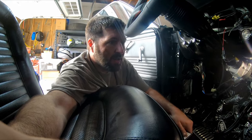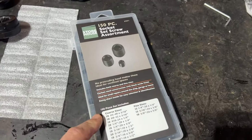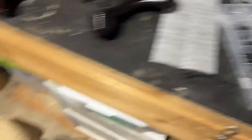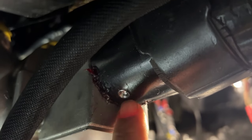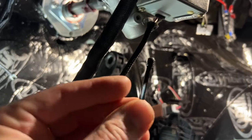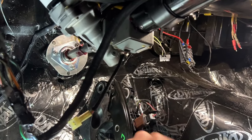I have a kind of custom setup — this is my ignition switch and ignition relay. I ran a yellow wire down to there and that is going to activate the unit when the power is on. When I click it on, you can hear it click. It does activate, but it's impossible to tell how much assist I'm getting right now because I don't have any wheels and I don't even have the steering system finished up under the hood. I did move this dial back and forth and noticed a very slight change, but until I get the tires on and on the ground, it'll be impossible to really tell. It is smooth as silk and feels very nice.